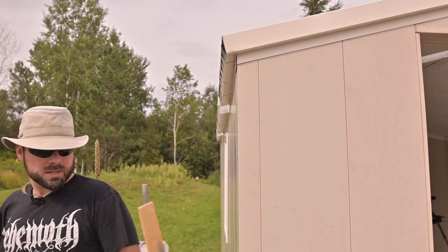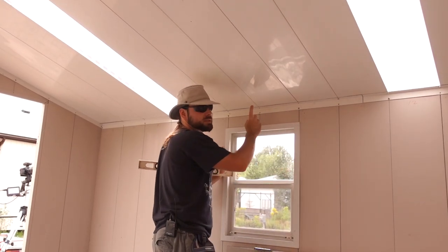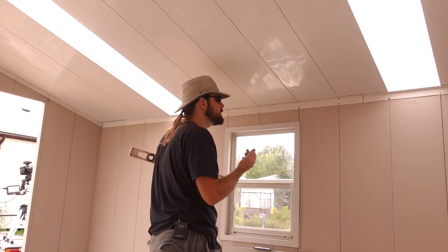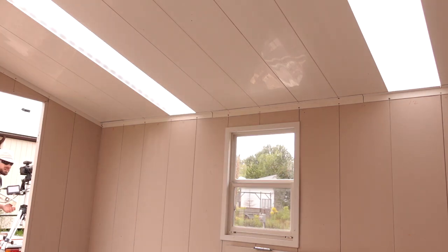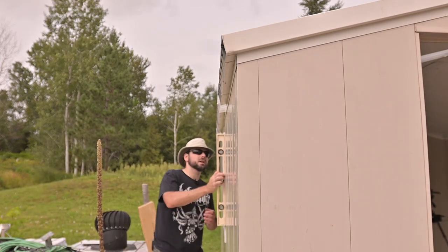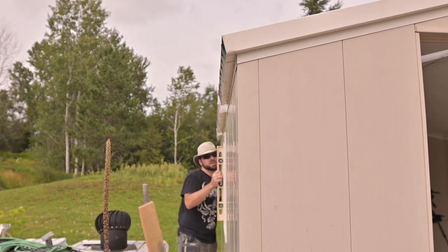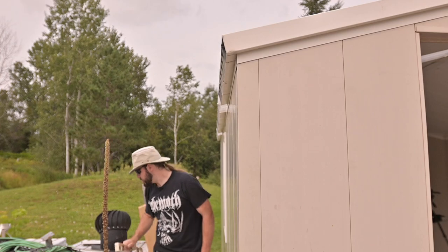So on the inside, we need to properly push on this. You see, it even raises the roof a bit. And of course, because my ceiling panels have all moved here, you can't really reference the original hole. Now, how's that look? Oh, a little bit sketchy right above where the window is. Let's see. It's actually out a bit too much. So we're gonna get these window panels till they show level. Now I'm gonna screw in these four panels and then adjust the others around it.